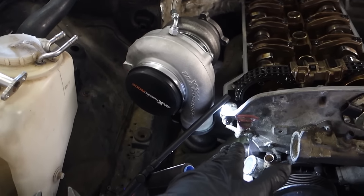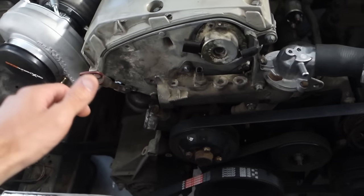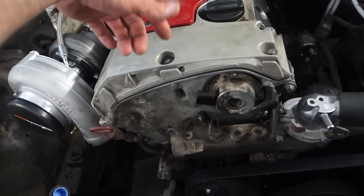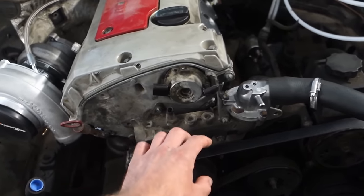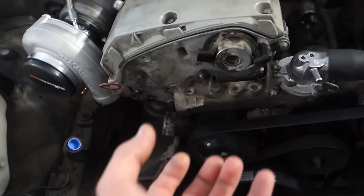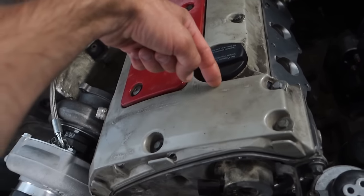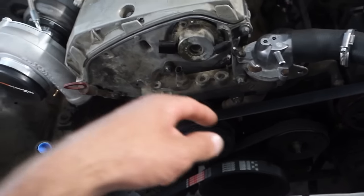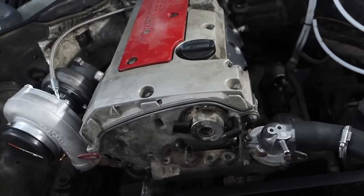When fitting chains during a complete timing disassembly, I recommend locking both camshafts with two pins, setting the crankshaft to 20 degrees, then laying the timing chain around — place the sprockets, position the VANOS on exhaust. Make sure the VANOS and camshaft position are fully retarded, then check timing as shown. If you do that precisely, you'll get everything spot on.